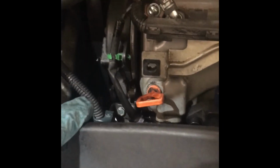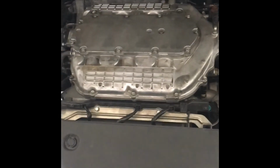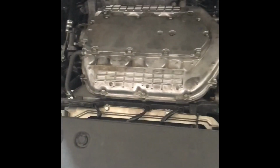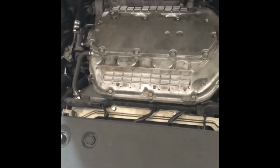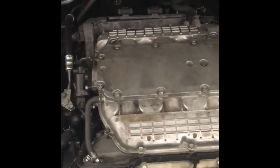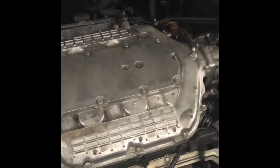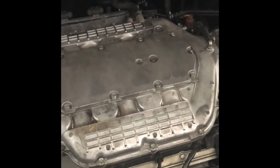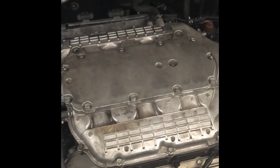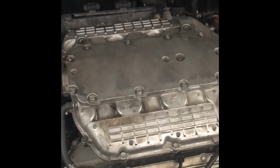Just make it kind of snug, because you don't want this to open and fly out, since you will get pressure. And then put your engine cover back on. Hopefully, you won't be burning as much oil. Because if they get plugged up, like I said, you'll start burning more oil, and you'll start getting things like valve cover gaskets leaking, or maybe a rear main seal leaking. Yeah, it can cause that as well. And hopefully maybe you'll get some better fuel mileage.